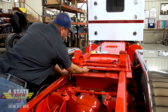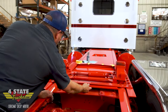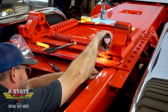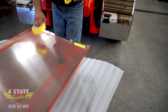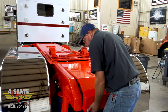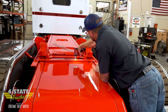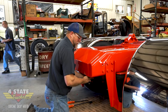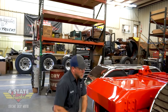The back of this fifth wheel deck plate — same thing — I've got to have a spacer put in here, and it's going to come over to the rear and then bolt the front section in. I made a panel with some quarter-inch nutserts into it, and what I'm going to do is attach it so that when this rear section goes in, it gets sandwiched in here, and then I'll just pull it up from the top. All right, there's all three pieces of our flush mount deck plate from the front to the rear.